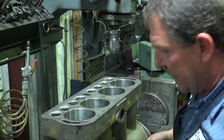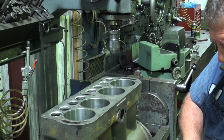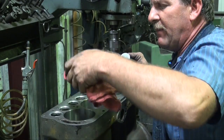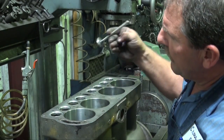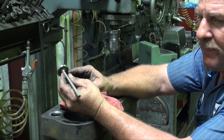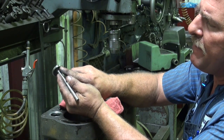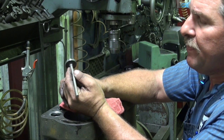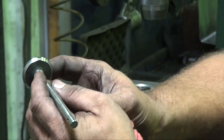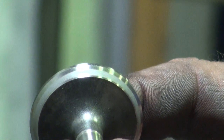It's a really fast way to get a picture of what we need, a picture of where we're at, and to verify our valve and seat. As you can see, we've got a bottom third of the valve. Yeah. We still see some of our valve face. We're at that bottom third. That actually, we're utilizing the majority of the valve, all the valve that we can for the life of this engine.